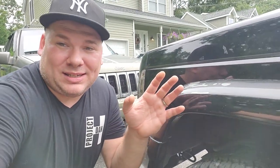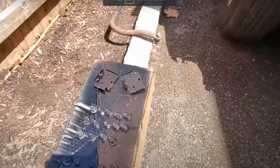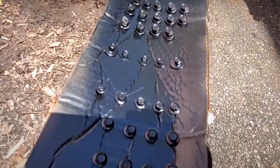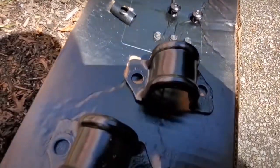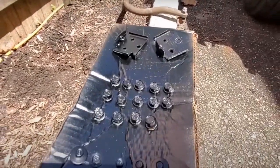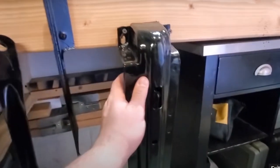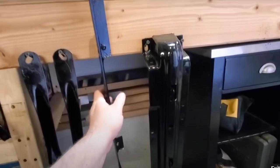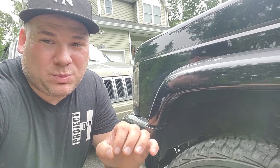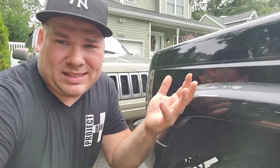Now, I don't always do that process. Most of the time, I'll finish it up with some paint. Check out the fasteners I cleaned up and painted. Now, all these went in the tumbler, and then I hit them with some brake clean to get any oils off, and painted them up. It came out really nice. From now on, I'm going to be tumbling the bolts and then putting Por-15 on them. Here's all the other parts. Por-15. Nice and dry, nice and cured. That seems the best way to go, because all that hard work I did, looking rusty. So I don't like that. I wish I did it differently.